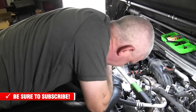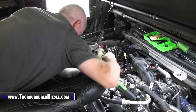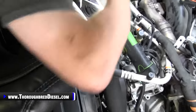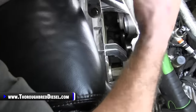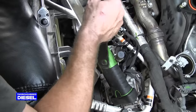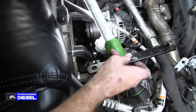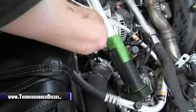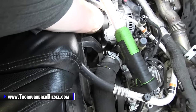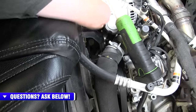Talk about the tensioner for just a second on LMLs. You can get to the tensioner to be able to take tension off of the belt from where we took the fender well out as well. But if you've got one of these serpentine belt tools that you can rent from any auto parts place, you want to use the 1/2 to 3/8 drive adapter, and you can put it in the tensioner, and it's kind of a booger.